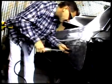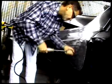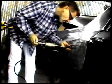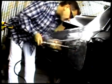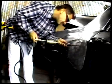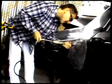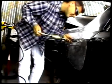As you can see, this is the welding gun, electrical, welding tip, put the nails in the tip, and that's how they stay on. Then we take our hammer gun, we connect it to the nails, and we pull the dent out. You use the various nails to get the different areas. And then we cut these off with a disc and make sure that it's straight.